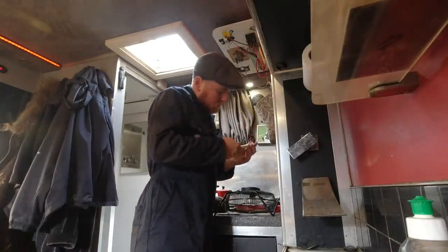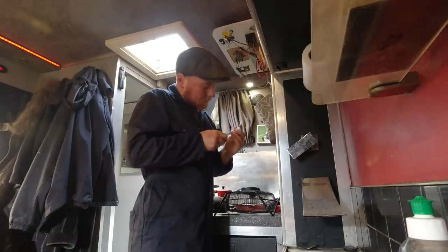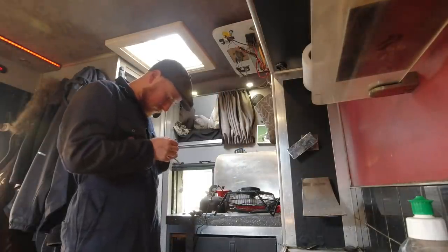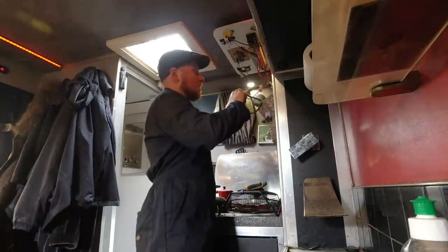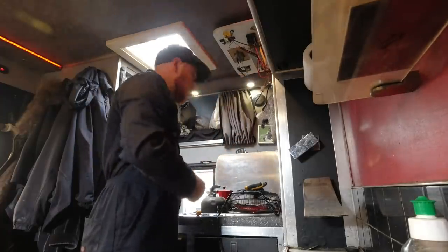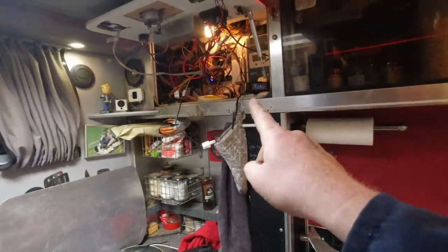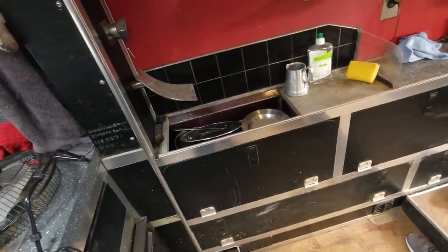I've wired up the three controller wires with corresponding wires from the loom. I'm rigging them temporarily to make sure the controller comes on before making proper ends. The cable quality was pretty poor. I nearly put the green on the wrong wire — but that's all connected up now, tapped into the ambulance wiring and going down into the diesel heater. The diesel heater is now basically ready.